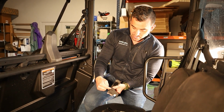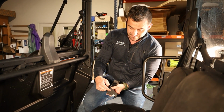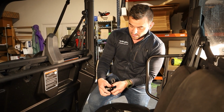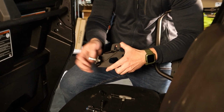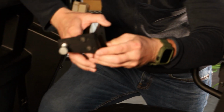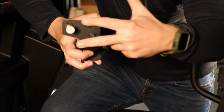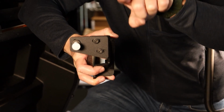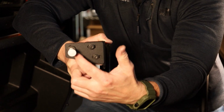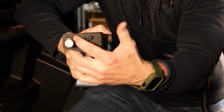So we've gone ahead and put the 6mm by 15mm bolts here, and we've got our door striker pin, which has 2 nuts on either side. We just feed it through here, and that allows you adjustment that way in the actual bracket itself, and adjustment that way in the slotted pin hole.